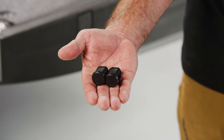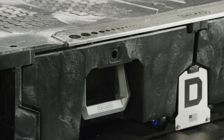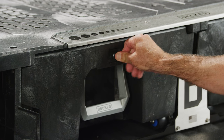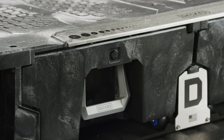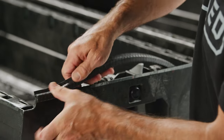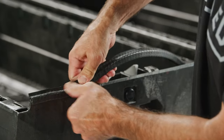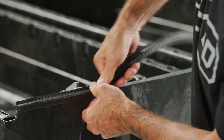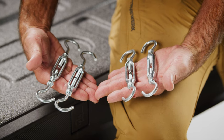Install the drawer lock plugs or drawer locks if you purchased these — for instructions on how to install locks refer to the video at decked.com/install-locks. Finally, install the weather strips, taking care that these are installed with the angled blade pointing towards the cab of the truck. Do not install the weather strips backwards — that will funnel water into your drawers instead of keeping water out.